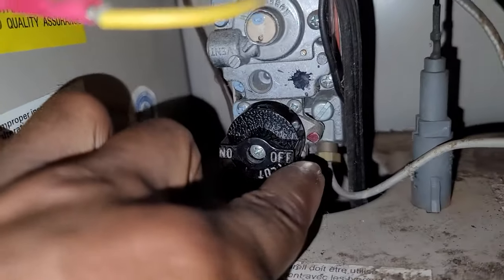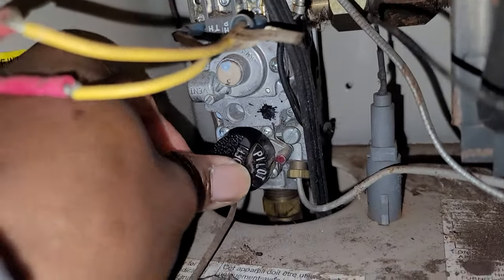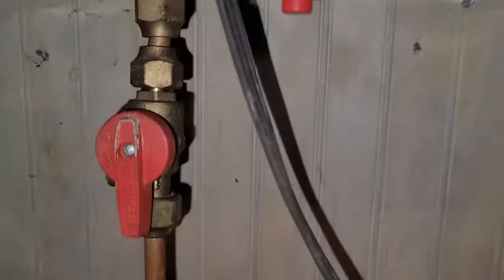Your tank is on. Come up here — see the little indent? That lets you know what position you're in. Right now it's in the off position. So you turn it counter-clockwise to pilot, and then you push in on it. Push in. And while you're pushing in — see that red thing? That's the igniter. I'm going to try to do it. Can you see the flame? I'm going to have to turn the light off. See? That's the pilot. You have to keep it held in for like a minute. If you just light it and release, it'll go out.